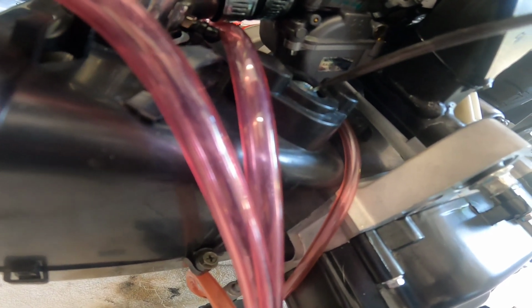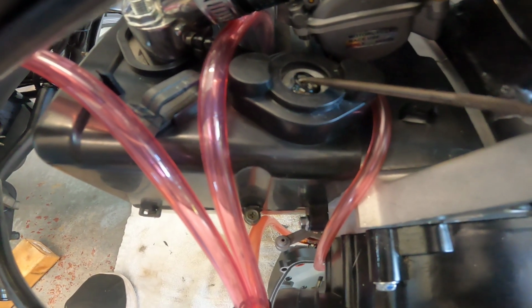It should be spring loaded. It looks like there's a little O-ring in there. I'm going to take that out, so don't damage it. That little flathead screw in there, we'll try turning clockwise and see if it pulls the tension off that chain. They make a tool, that's what these little notches are for. Once you pull the tension off, you can push it down in there and the tool gets bigger, stays in those notches, and holds the tension off.